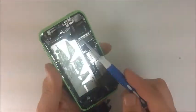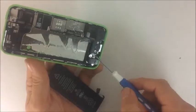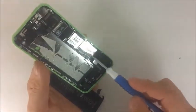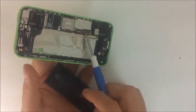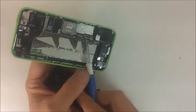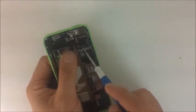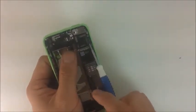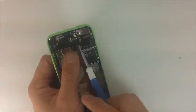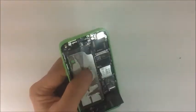Here's a brief overview of the micro parts and micro components of the iPhone 5C: that's the headphone jack, that's the home button receiver prongs, that's the charging port, that's the loudspeaker, these are some integrated circuit chips, we have the battery receiving dock or pad, the charging port pad — both of which can be soldered and desoldered — the power and volume button flex receiver, the back camera, the front camera flex which also includes the loudspeaker microphone and proximity sensor, and the digitizer flex.